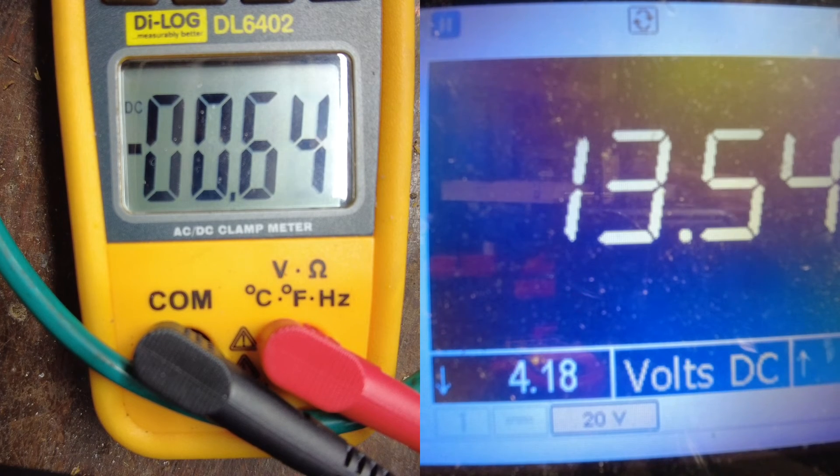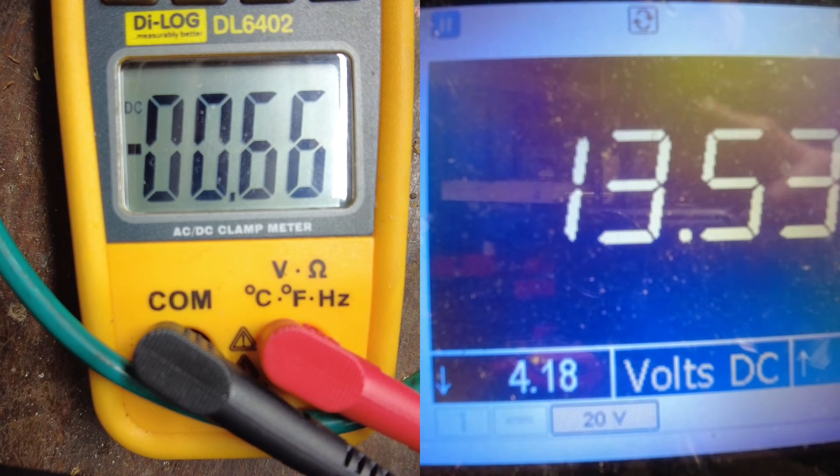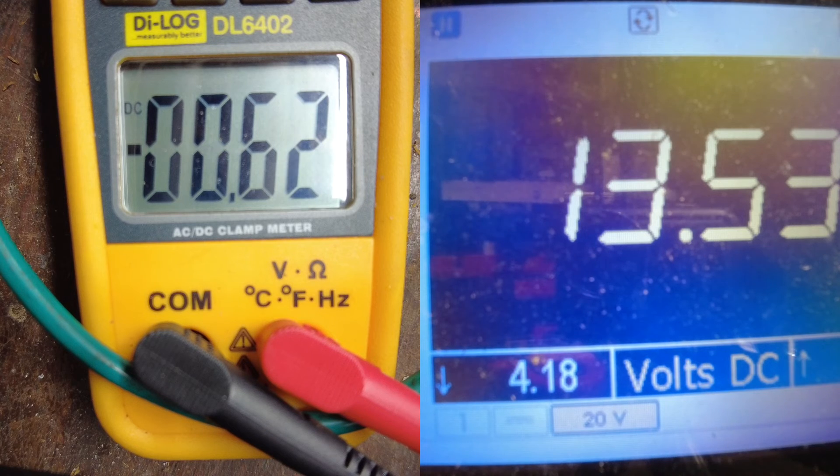I put a light across it just to take the surface discharge off. You can see it's still dropping — not by much — but this is what happens on your Yaris because of the continual drain. I hope you can now see why your batteries are going flat when you don't use the cars, because this is what's happening all the time your car is stood idle. Over a period of days this voltage is dropping continuously until it gets to a point where it will not start the car up. I just hope that explains a little bit more as to why this 12-volt battery issue is happening.